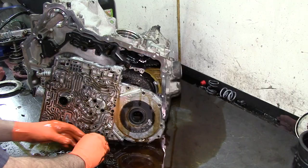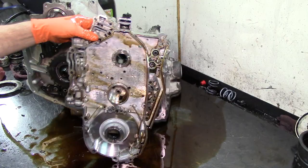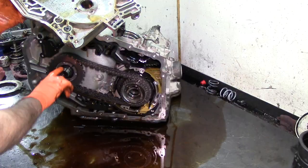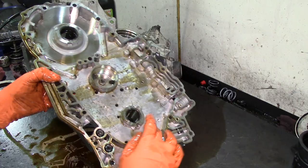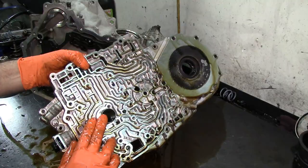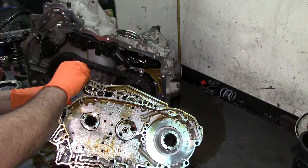Get out of the way. This is our channel plate. Now right here, you've got to inspect this sleeve. That sleeve right here is available separately. Two O-rings work here. Sometimes the bearing wears out and it digs grooves into the sleeve. If that has happened, this is available separately, so you can replace just this sleeve here on the channel plate. We have two guide pins here, or dowel pins. Can remove them.